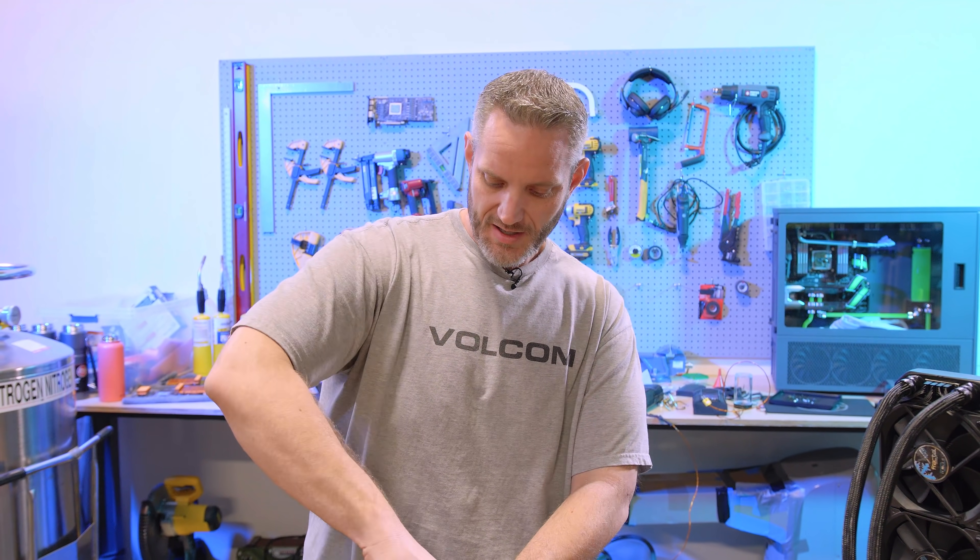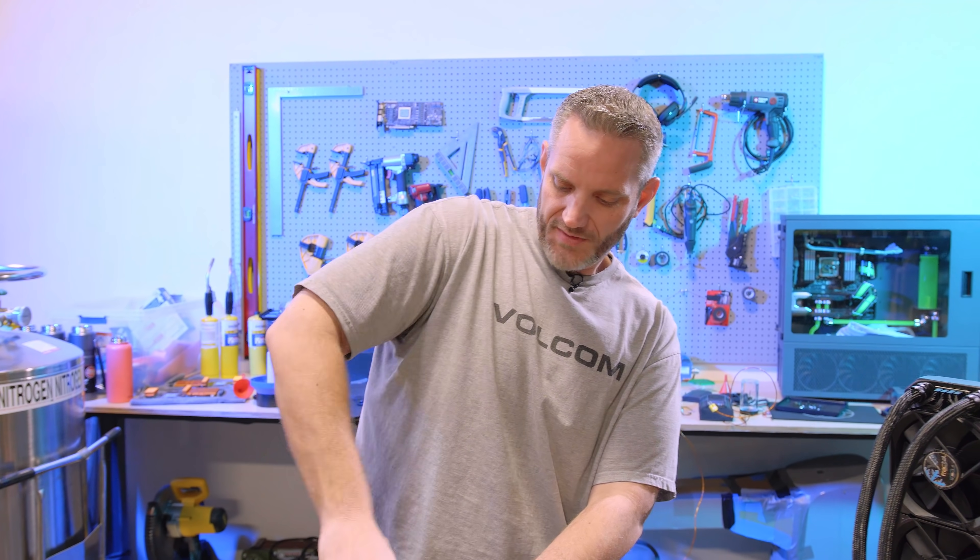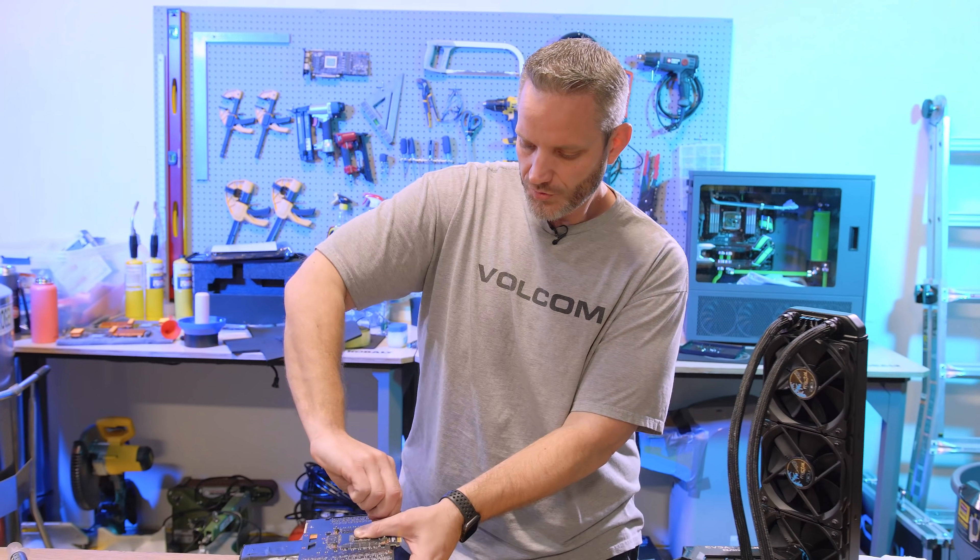I was dealing with paste cracking at around minus 145. And sometimes if the test crashes and there's LN2 in the pot, even if I'm blowing a torch at it, it still runs away and then it cracks the paste. We're constantly doing paste healing, and I'm trying to at least get to a point where I can get those first three or four runs to truly count.